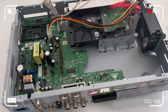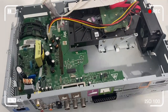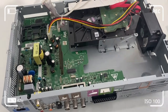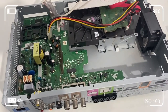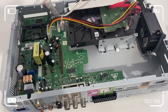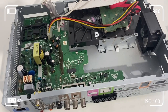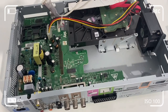Looking back at the main board, we've got the power supply unit right about where we've got the transformer — right in between the high-voltage area on the left-hand side and the low-voltage area on the right-hand side. There are a couple of components bridging both compartments, but there are also slots there to prevent any sort of bridging. On the right-hand side we've got some analogue and digital circuitry — basically analogue and digital audio. The smart card area also encompasses an AXP chip usually handling voltage conversion for the smart card interface, communicating between power, the smart card, and the CPU. There's also a basic microcontroller for the microchip, presumably providing some form of bus logic communication between boards and the CPU.